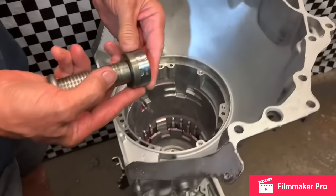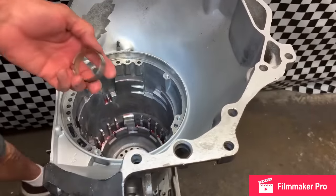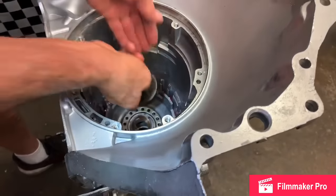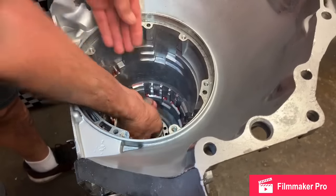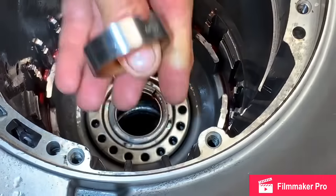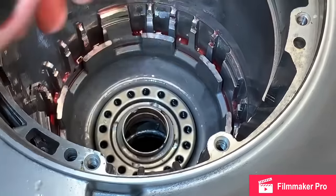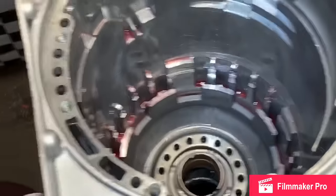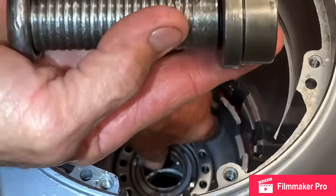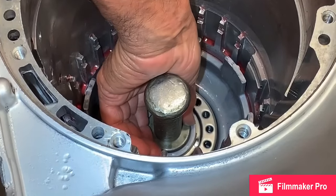to never use the original driver. You always want to come in with something a little bit bigger and go on top of it and put it down in there like that. That way the bushing doesn't get put in crooked. The bushing's not very wide, so it's easy to put it in crooked. Once you put it in with your flush driver like this, then you can come in here with your other driver and put the depth in it.